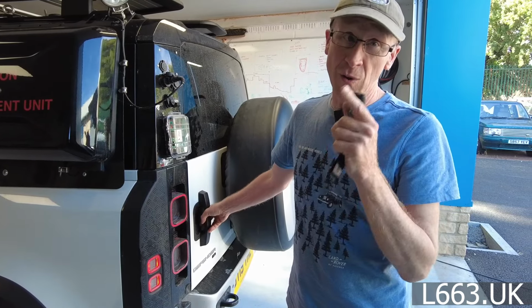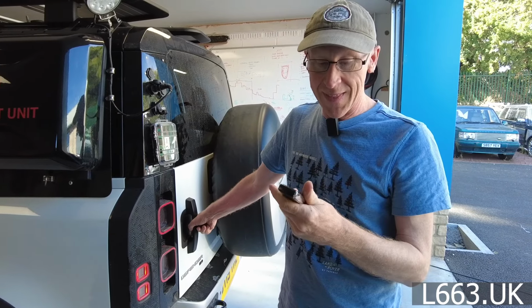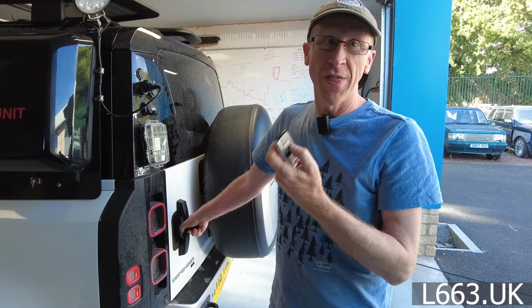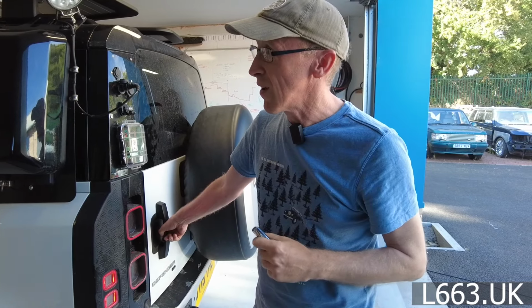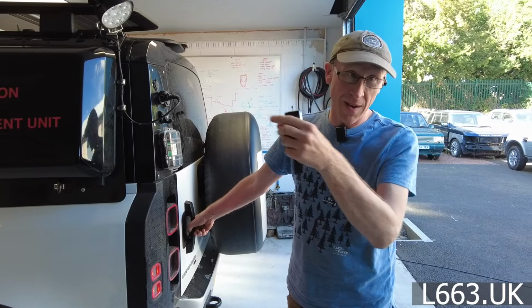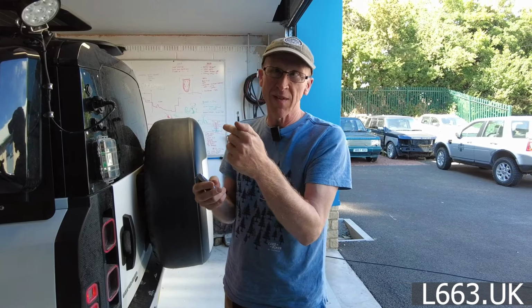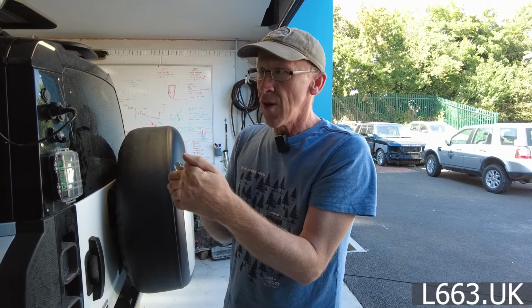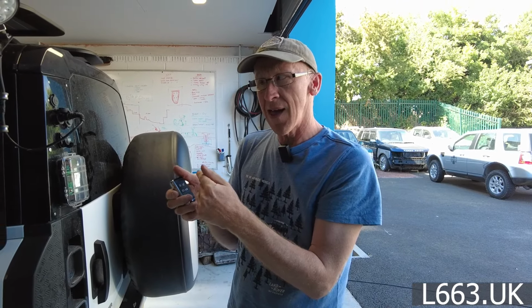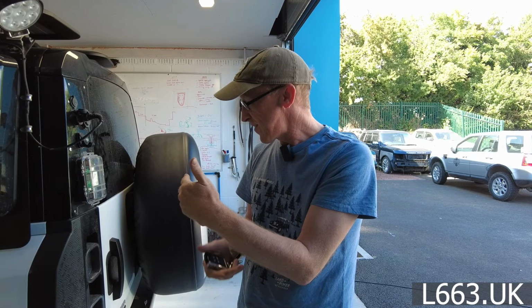He said, Simon, can you look inside those secret CCF files and have a look whether there's a setting for the remote? And I think I found it. I had a look last night. So we are going to have a quick look. I'm going to get the computer out and plug our little cable in and see if I can change it, because I think it says, well, we'll have a look what it says, but I think it says remote tailgate, and on the setting for my car as it is now, it says disabled. Let's see if we change it to enabled, whether it works.